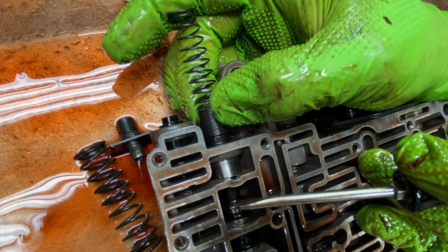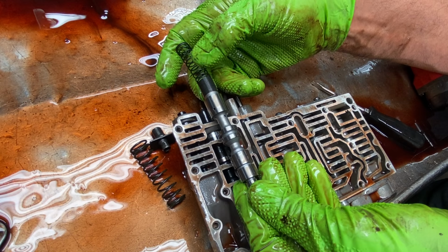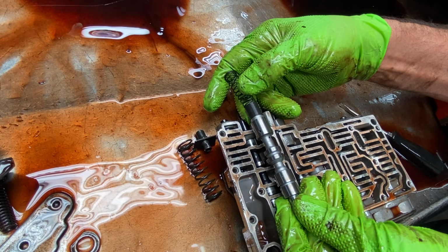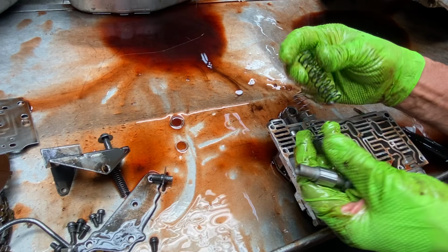Well, if that does that, and you put your Sonnax full-time lube valve in here, now what do you got going on? You got two lube circuits happening. We don't want two lube circuits at idle when this truck's sitting at 220 degrees pulling a big gooseneck trailer. What happens is it'll physically drop line pressure and we possibly could burn up clutches and stuff like that, and that's not what we want to do. So what we do is we end up leaving these pieces out, and we still use these two springs.